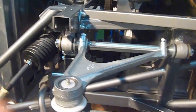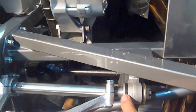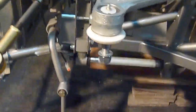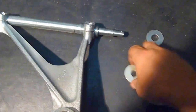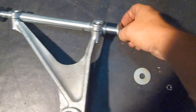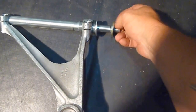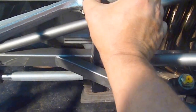What I had is the top ball joints. When you buy these new top wishbones — or A-arms as the Americans call them — they come pre-fitted with the ball joint in them. One thing to be careful of when setting this up: make sure you put the spacer, washer, and then the special washer on the end. They are different, and you can't make a mistake on them, because this washer here has got a slightly bigger hole in it. One sits right up against the shoulder on one side of the bushing, and the other goes right through on the other side, because the bushing needs to be gripped so the rubber doesn't get damaged. It will bear against the spacer tube inside.